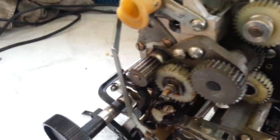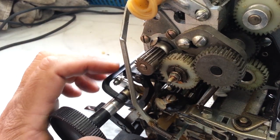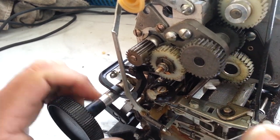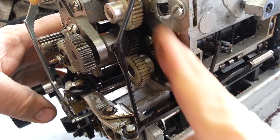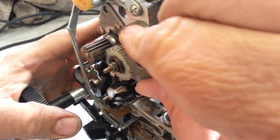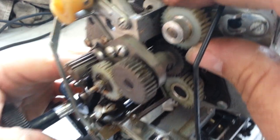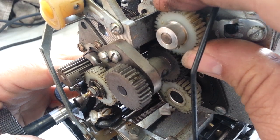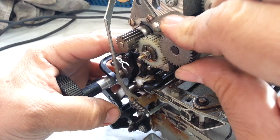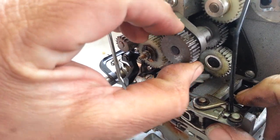I'm thinking it's going to be these gears over here — this particular gear. Let me turn this thing off before it bites me. It could be this gear pack or one of these bearings. These have bearings on both sides right here along the frame. I'm just going to wiggle this and see if anything moves. This piece does move, just wiggles a little tiny bit — so that's probably good. I can feel a little movement here, so that's probably good.